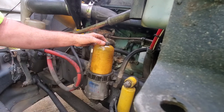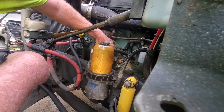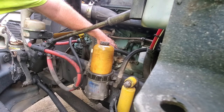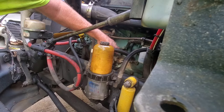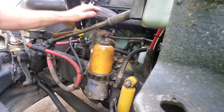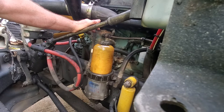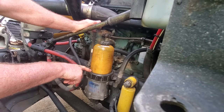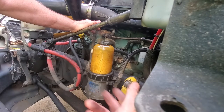If I knew I got some air in it, I'd reach over and hold the gas pedal down about three-quarters or even full while turning the key until it fires up and revs the first time. I'd let it rev to about 1,500 RPM, then pad the gas to keep it between 1,000 and 1,500 RPM about eight to twelve times, then let go. As long as it doesn't fall below 700 RPM — which is what my truck idles at when warmed up — I watch it and usually the level will come up to just a hair above this ring.